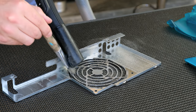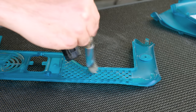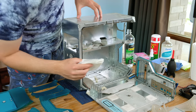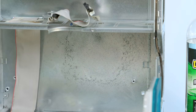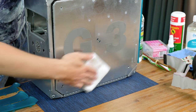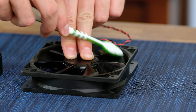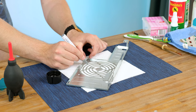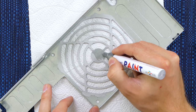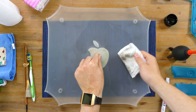Moist air over time has caused the dust accumulated on the air vent to start corroding the metal. I also dusted off every other piece of the Mac, including the power supply. Even using some methylated spirits, part of the casing couldn't be easily cleaned due to pitting on the metal surfaces. The G3 logos on the side looked so much cleaner after a rub with some metho. I also scrubbed the fan blades with metho to remove the last of the dust. To reduce the corroding metal on the fan vent, I scrubbed it clean before going over the surface with a paint pen. I realise this probably won't save the metal in the long term, but for now it looks a little bit better. The weird patterns on the plastic actually appear to be dust, so after a quick cleaning they look pretty nice.